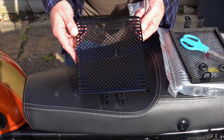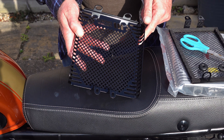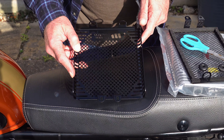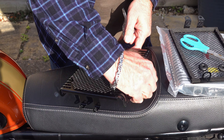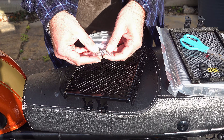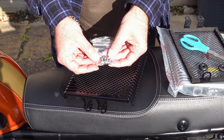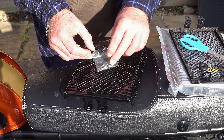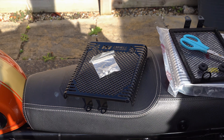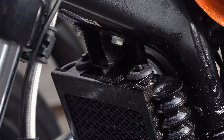At the same time it enhances airflow around your oil cooler, optimising its ability to cool your oil. It isn't just designed to look nice — it's designed to enhance cooling as much as possible. The wraparound design means more of your oil cooler is protected from damage. Enfield Precision have gone for a fairly standard geometric grill design with just one or two embellishments at the corners and top dead centre with the Enfield Precision trademark. It comes complete with stainless steel fasteners to replace the original steel ones.